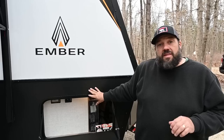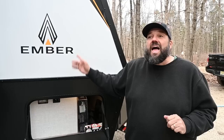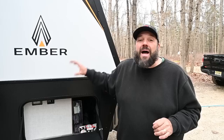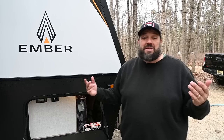When we go inside I'm going to turn the air conditioning on for you. The standard solar comes with no batteries — you'd work out batteries with your dealer — one 190-watt panel, and a 1,000-watt inverter. Everything is still inverted except the microwave and air conditioning on standard solar. A lot of people buying these are going Max Solar with two lithium-ion batteries, three 190s, and the 3,000-watt inverter. You can also go Max Max Solar by adding two more Battle Born lithium-ion batteries for a total of four, giving you more battery life and more time to stay off-grid.